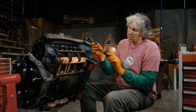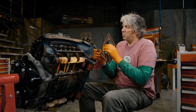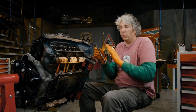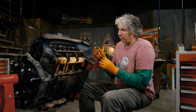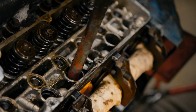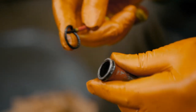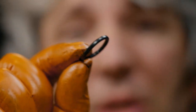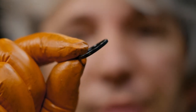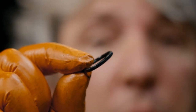What's actually been leaking is little O-rings, top and bottom. Over time the O-ring gets hard, and as it's expanding and shrinking all the time, the oil can actually start leaking past. So we change that on all of these and on both sides, and hopefully that'll be one leak stopped. The O-ring is a little bit softer than I was expecting, but you can still see it hasn't got a very good profile — it's flat on the edge, and it's that flat which is actually letting the oil through the seal. Once I've refreshed all of these with new seals, we should be good to go. That's the last of those on this side.